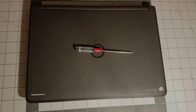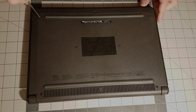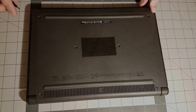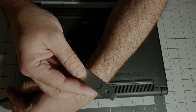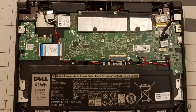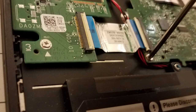You're going to need a small Phillips head screwdriver to remove the back panel of the laptop. There's a write-protection screw on the motherboard that needs to be removed before you can install a different operating system. Removing the back panel is simple enough — there are seven screws that need to be removed. Then use something small and thin to get leverage to start prying off the back panel. I used a tiny flathead screwdriver and a PC backplate as my prying device. Once you get the back plate off, here's your motherboard. This is the screw you need to remove — it's marked WP.